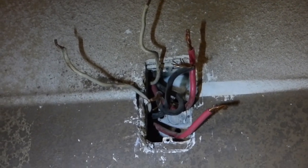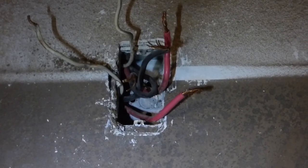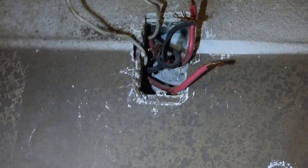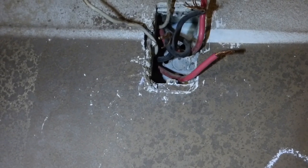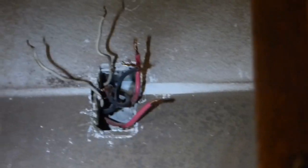Up here while I was done wiring it, I found a little surprise - there's two reds and two blacks coming out of the wall, and two whites. That really means this circuit, when I turn the breaker on, one black will be hot, one red will be hot, and the other pair will also be hot. The pair of red and black will be hot going to the cooktop - it branches over to the electric cooktop. I'll have to rewire those up together temporarily if they want to use the cooktop while the oven's waiting for a new cord.